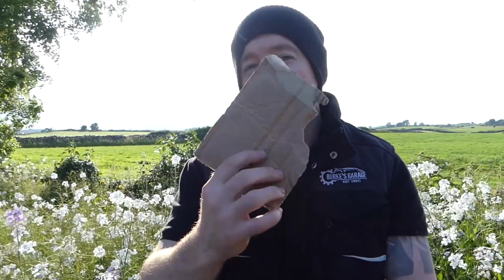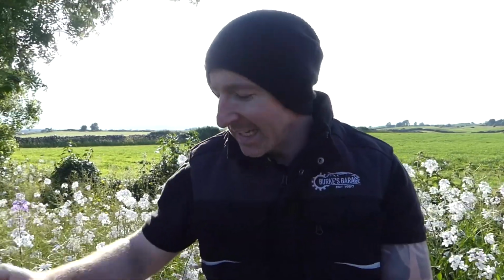And especially when I'm working up around the top side of the cams, or say if there's a fuel injector pump or something on this side, I can work on the top side of the engine under the bonnet and not worry about the belt slipping away on the bottom side and me having to re-tension it again. So cardboard, completely free, comes with every timing belt kit.